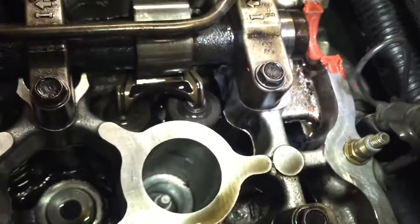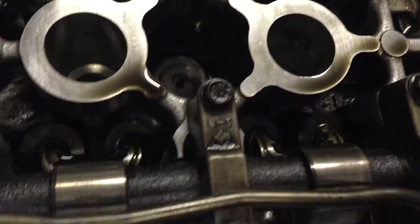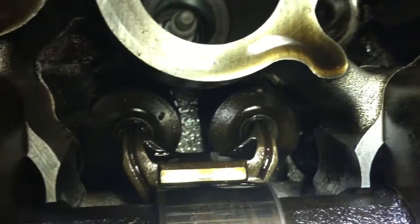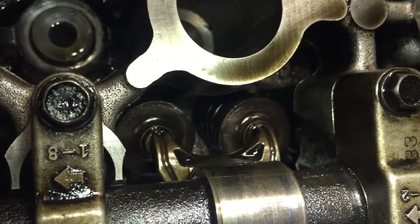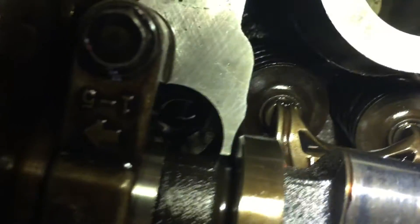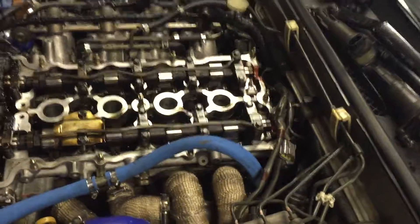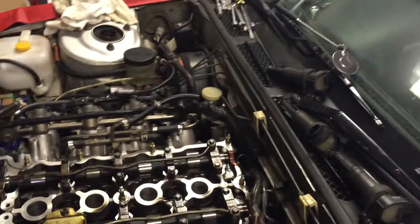From your point of view, if you're looking at the motor on the exhaust side: guide on the left, flat shim on the right, all the way across each valve. If you actually pull out your rocker arm, you will notice that they only fit in on the left side and not the right side.